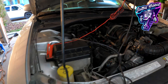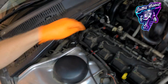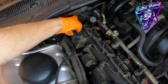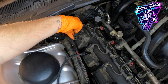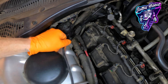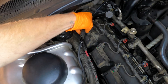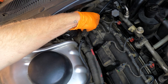So when you induce smoke, what I did is I disconnected the hose coming from the rear of the vehicle — from the tank or the canister. This is your vapor purge. This bottom hose is the one coming from the back, and the top hose right here is the one going to the intake. I used the hose from the smoke machine and plugged it right into the hose — just like that. So I'm inducing smoke into the whole EVAP system, to the back of the vehicle, to the canister.